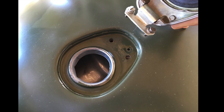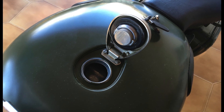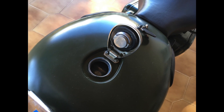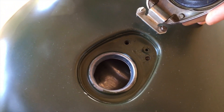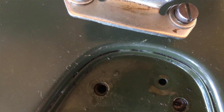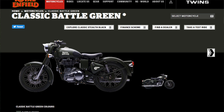One of the most annoying things about the bike is the breathing hole underneath the fuel filler cap, which allows air in as the fuel is sucked out from the bottom. However, it sits in the bottom of a dip under the fuel cap, so when it rains it fills the tank with water. I only found this out by going out one day after a rainstorm and the bike spluttered for a good five minutes. I got home, checked the internet, found out what it was, cleared the problem, and it hasn't occurred since — it quite quickly sucked the water through without causing any damage.